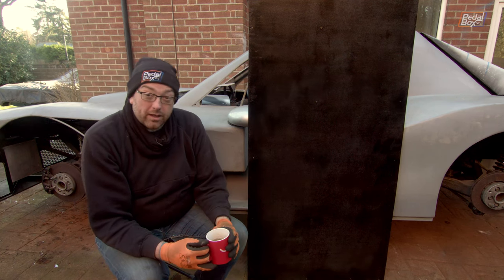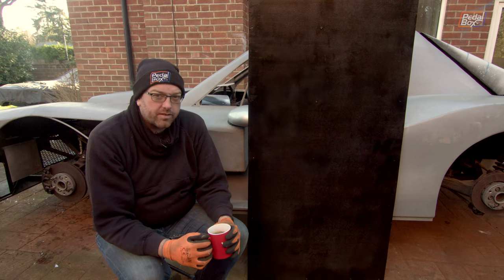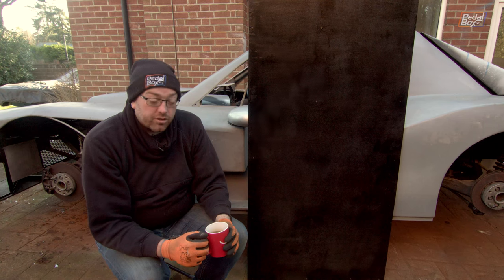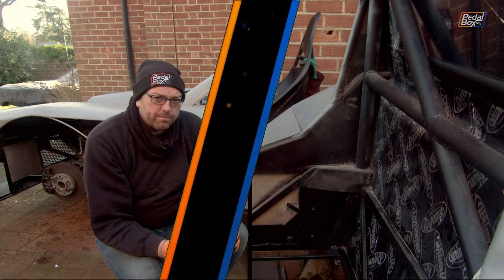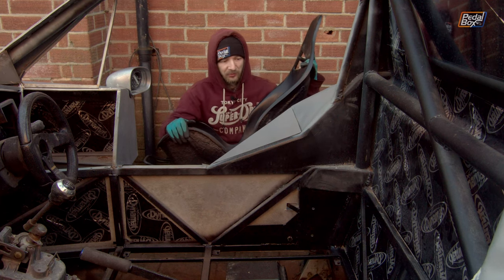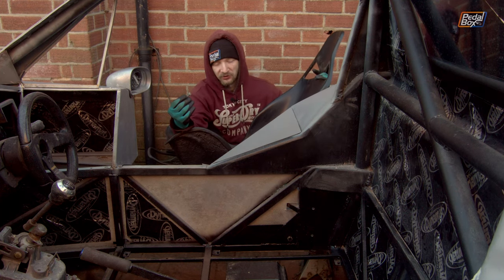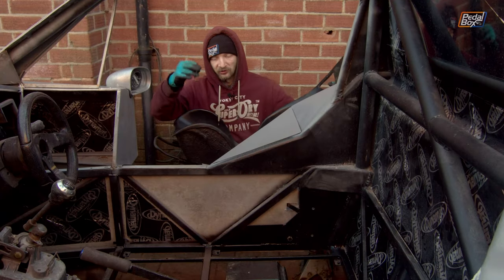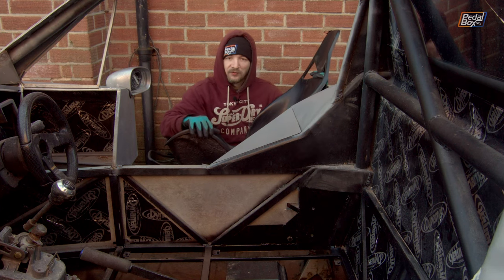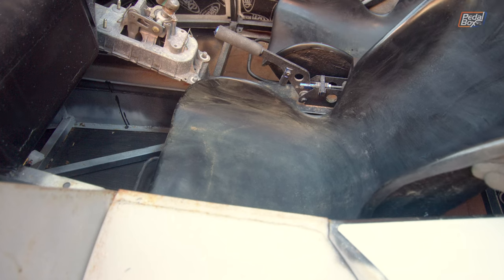So this morning we're going to fit the last panel, but before we do that we've got to put the seats in. We've already taken the ice out from the seats yesterday — fortunately there was no rain, so there's no more ice. They need a bit of a clean, so we're going to bolt those in while the drill charges, because we also have to drill out all of these holes to make it a little bit easier to locate the bolts. It's finally time to put the seats back in. We've managed to lose all of the original bolts that we were using — which is kind of fine, because they were M6, a little bit spindly, and never going to be fine for going out on the road. So we've prepared some M8 bolts out of the TT that we've salvaged. We've ground the sides off so that when they sit in the runners, they don't rotate — they're self-anchoring. Being M8s rather than 6s, they'll be a lot stronger, and they'll hold the seats in place a lot better in the event of a crash. There are a few other safety changes we're going to make — we're also going to sleeve the little half-inch box sections, but we don't have the bits for that right now.